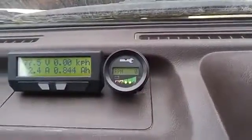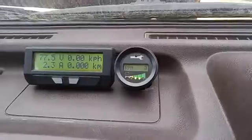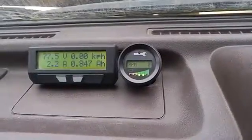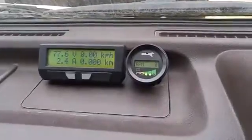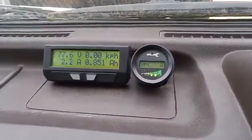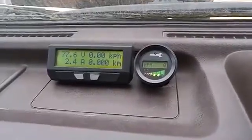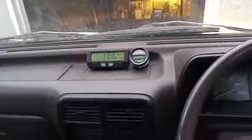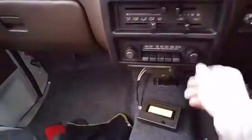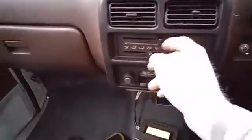The top one will flash for service issues. It gives codes that you can look up on the internet for the controller model. The bottom is sort of a rough voltage approximation thing for battery capacity, but it's calibrated for lead acid, so it doesn't really do anything. Other than that, radio, AM radio works just fine.